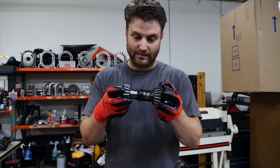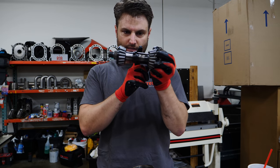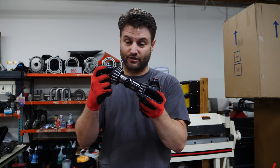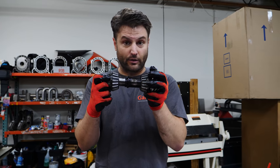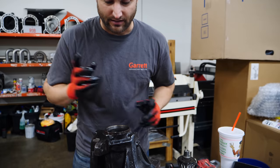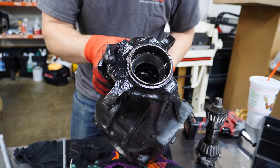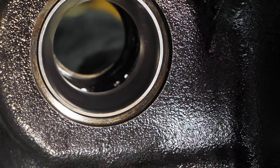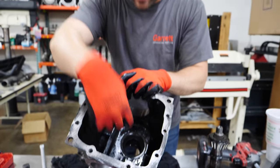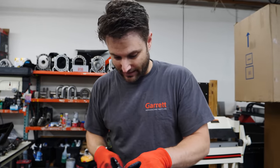With the same concept as the rest of the diff, we need to be able to adjust the position of this pinion between these two points. It's not in my hands — this part is just kind of set as it is, you get what you get. So where is the adjustment? This is the part that sucks — the adjustment is here. We'll have to pull this race, and then there's another one on the inside. You literally have to disassemble the whole ring part to get back to the pinion, retest, and pull those. That's a nightmare.